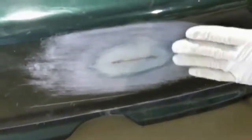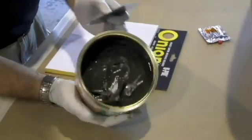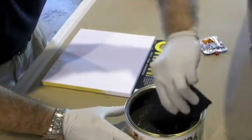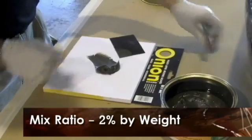Then we will come to the front side and use the 706-1 just like body filler to fill this area back in. Mixing the 706-1 is done exactly like standard body fillers. You can see that the product is dark gray, kind of a brownish gray in color. Just like with our standard body filler hardeners, we use a 2% catalyzation ratio with this material.